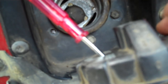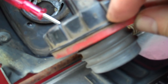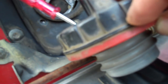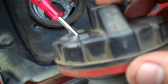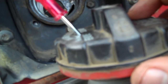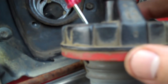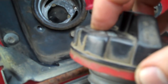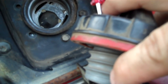What happens is this rotates on this. Inside there are some little hooks — what's called pawls, P-A-W-L-S. That snatching hook allows it to rotate and come off. When you stick that key in and unlock it, those pawls connect and allow it to rotate off. When you've got the gas cap locked, those pawls don't connect. When you unlock it, it allows them to connect and rotate off. That's what happens when you stick that screwdriver in at an angle — it locks this to this and allows it to turn and rotate off.